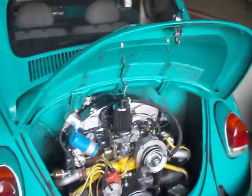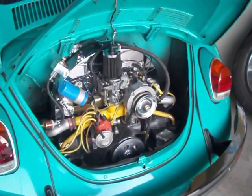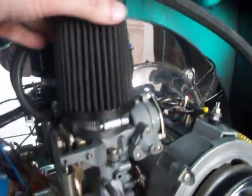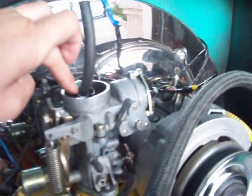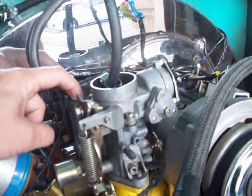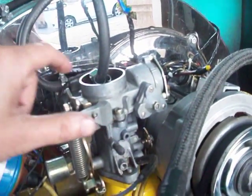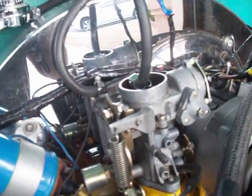That's with the diameter I have left. The way I made it work was I added a hose from the carburetor to that little tube that goes straight to the bowl. The reason I did that is because I'm trying to achieve atmospheric pressure at the fuel bowl. For it to work, it needs to be atmospheric — otherwise you need some sort of venturi inside the throttle body. Since we have none, I needed to simulate having a venturi.